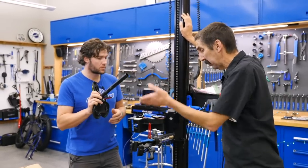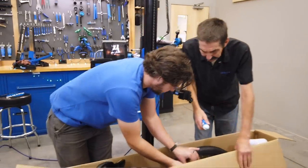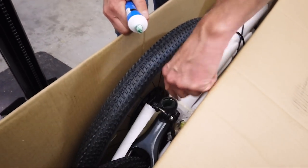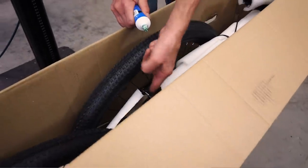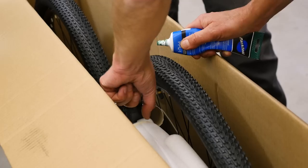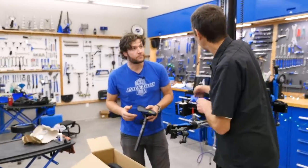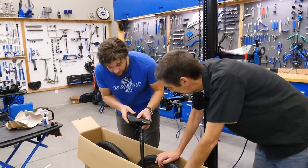We have a dry post and a dry frame. Here's a nice little trick — we're going to actually grease inside the tube. We grease inside because if we put it on the outside of the tube, a lot of grease would get wicked off before it went in. There's going to be some excess, but it'll be down inside where we won't see it. A little more grease further down towards the end of the post is pretty beneficial.